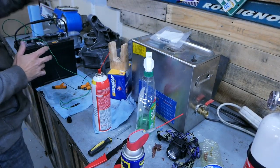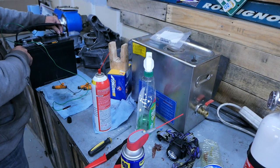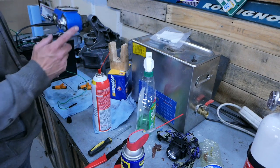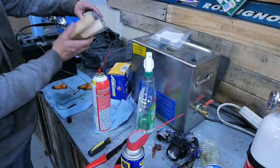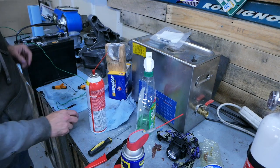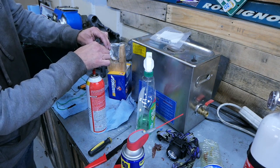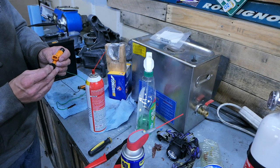There are about a thousand ways to do this. I went ahead and pulled a brand-new battery that I'm going to be using for this truck. I've hooked up the positive; I've got the negative here. At the end of these two lines I put just a couple of connectors. I'm going to take a bottle and put it between the wooden pressure plate remover that I had made for the transmission we rebuilt — now it becomes a holder. I also found a valve for an air conditioning system from one of our cars, and I drilled a small hole in the end of it. This will fit on the end of the tube so I have some pressure here with the carb cleaner. It will also fit on the end of this injector.